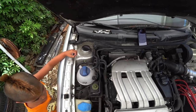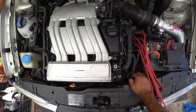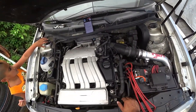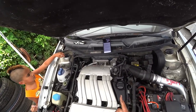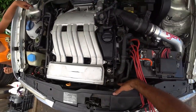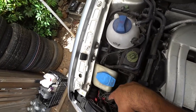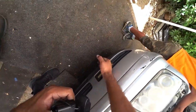That's for your AC. We got our upper radiator here. One thing you guys got to know — one thing that's super important about VR6s is they have two radiators. A lot of people didn't know that, but there's two radiators in this car and that's what this metal line is for. If you guys see where my finger is touching — right here — if we follow that, there's a metal line that goes across and down and there's a second little radiator down here behind your intake scoop.